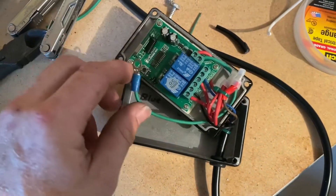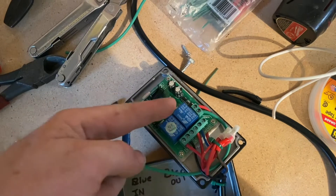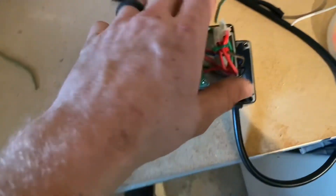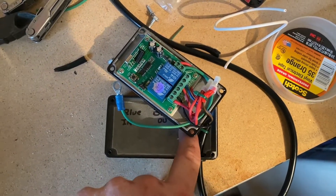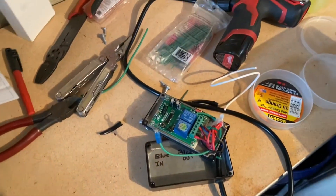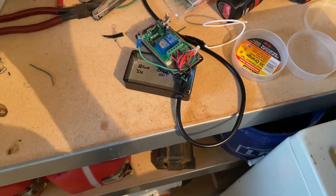That's pretty much how it rolls. Now we just need to drill some holes in this to mount it to the winch. You want to place your hole where it's in this little cavity between the antenna and the relays. I'm going to set this up, get an idea where that hole needs to be, and then put this guy underneath the hole when I put the self-tapper through. Then we're going to have a second hole drawn pretty close to the wire here. Basically all I have to do is push the wires in first and then shut it. Let's drill our holes and mount it to the Jeep.